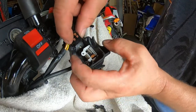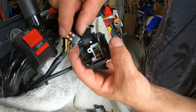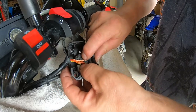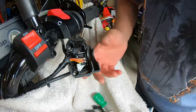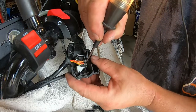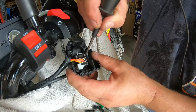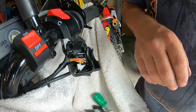As you can see, there are your four contact points. Quite often people have said these get dirty and don't make contact, but look at this one — it looks like it's brand new. Be very careful as things could pop out. So I've just turned the ignition on — there's power for the headlight. My problem is not in here. I've got an orange, a red-yellow, and a white wire — there's power up here, so that's not the problem.